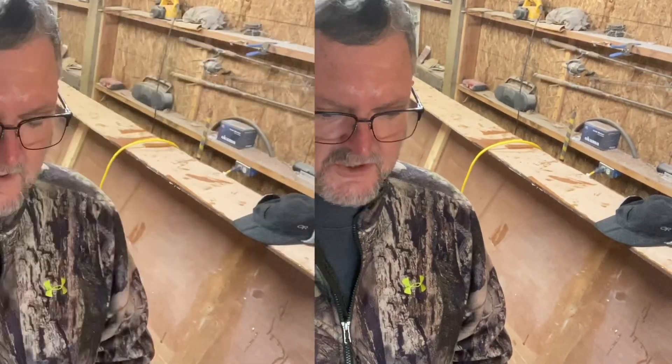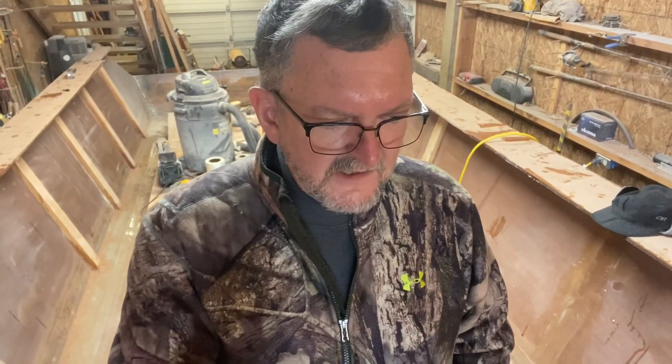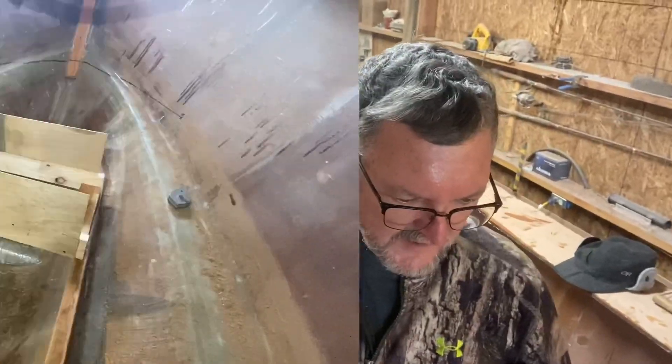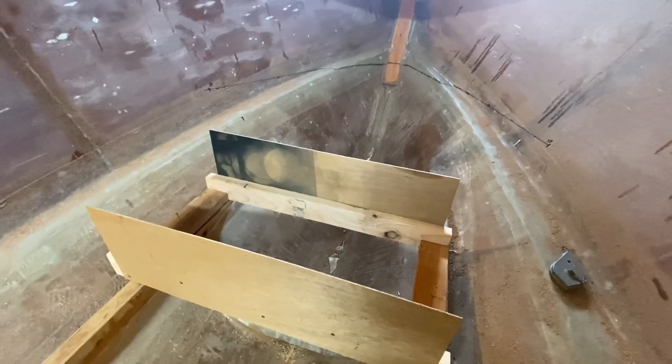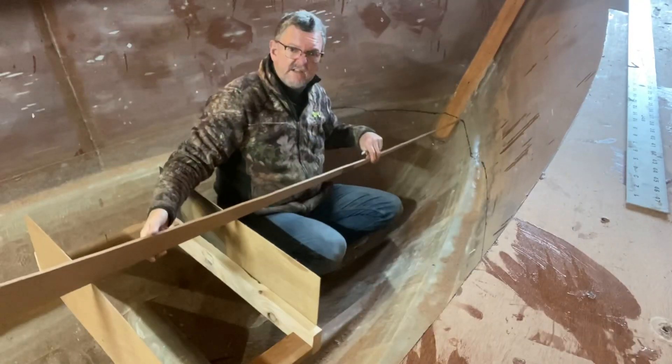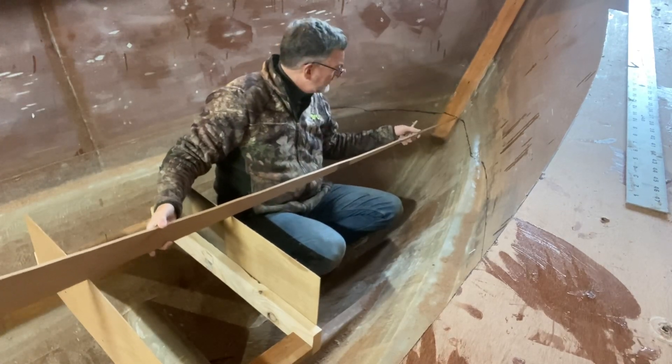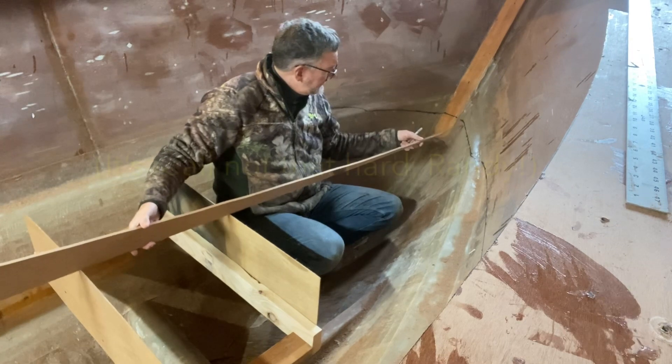What are we trying to accomplish? All we're trying to do is create a horizontal plane that is level with the stringers but 11 inches higher, straight to the front of the boat, and meet all those complex curves. So I made two of those jigs — just a 36-inch 2x4 with a cheap sheet of scrap plywood that is 11 inches high. Then using a straight edge, this scrap piece of plywood comes down to a nice point, which actually worked well, and I can just sort of move it around.